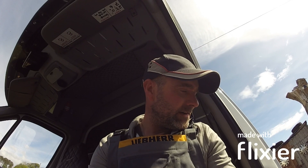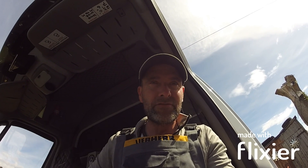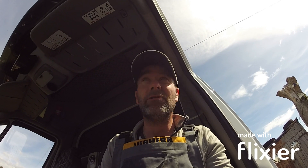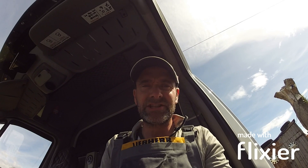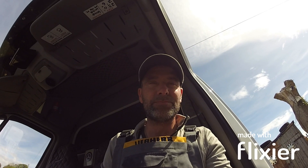So what I'll do is show you where the rust is. I've got the daughter's up in bed, wife's up in bed with her, so I've got an hour or so. I'm going to buff down the old rust back to metal and put some rust-proof primer on. I've got some marine paint which is pretty resistant to rust — I live right by the coast, it just makes it worse. Marine paint is a little dearer than automotive paint, but it's the same kind of quality and they're slapping it on ships and rigs all the time. I'm going to use a roller — may not be the best idea, but I couldn't get it in spray tin form. Plus with a roller you'll have a bit more control, make it neater than watching the wind blow spray everywhere.